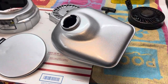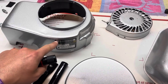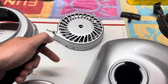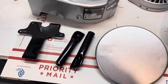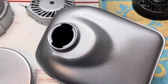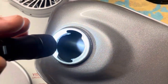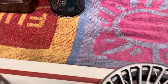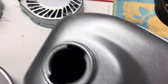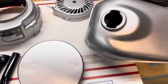Okay, so I got everything cleared up. Got the tank cleared, number plate, engine cover — masked that off. And then I cleared right over the sticker, cleared the pull starter. Don't worry about that pitting — got that all gloss blacked, so it's coming out really good. And then I did some tank sealer in there. It's almost actually the same color as this paint, which is funny. It's this fuel tank sealer right there — got it all sealed up in there for gas and corrosion.